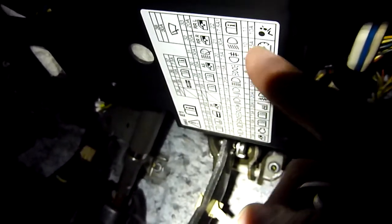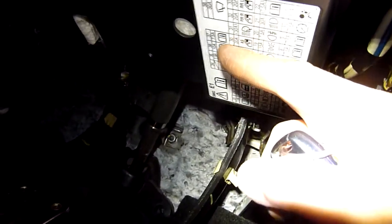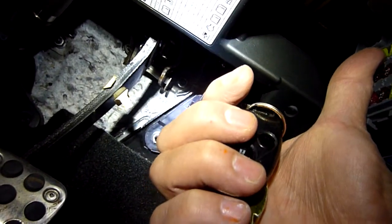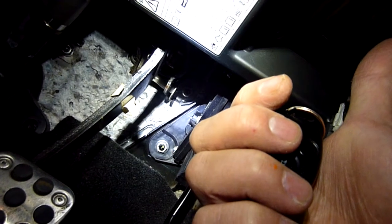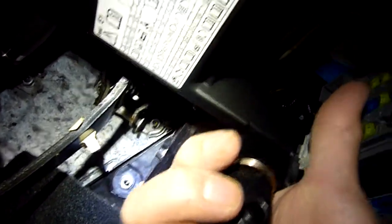That's absolutely impossible if your relay is busted. The fuse should be numbered 36, by the way. Looking at the fuse box — I can barely see the label — but 36 is up there. According to the Haynes manual, fuse 36 should cover the blower motor, aircon, heated mirror, and most importantly the rear windscreen heater. So if the rear heater is working, it's probably not this fuse.